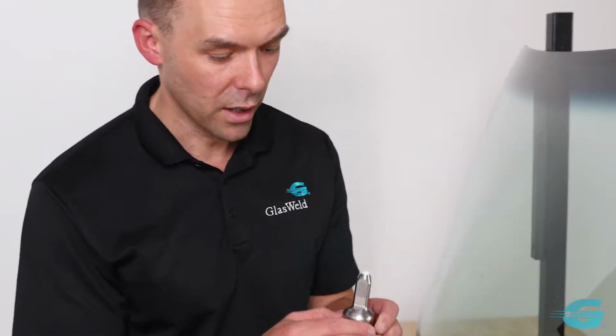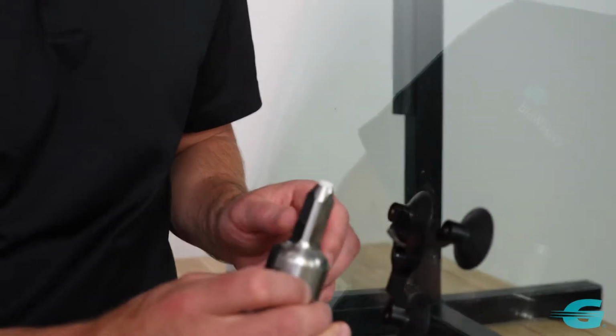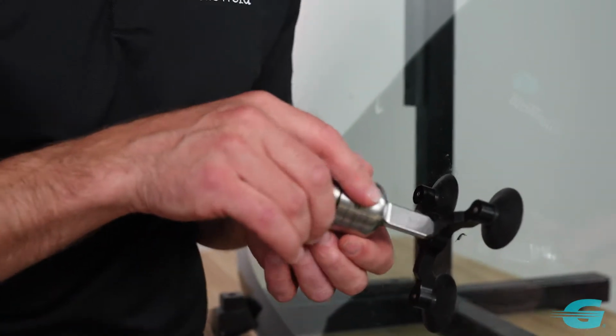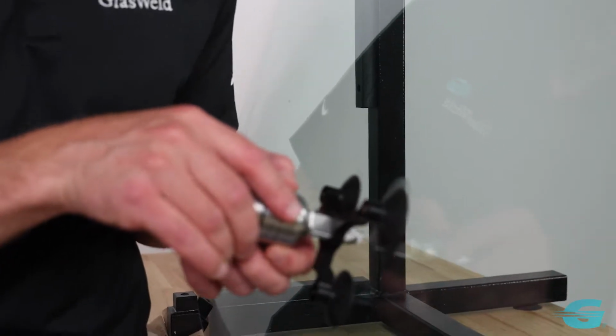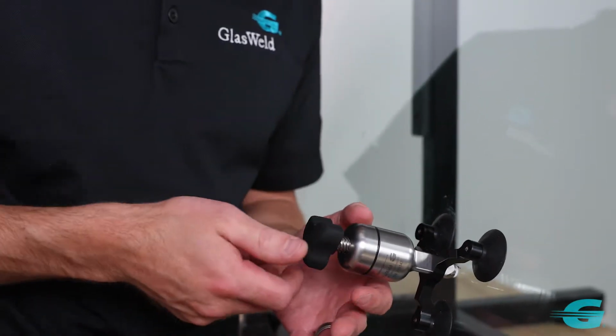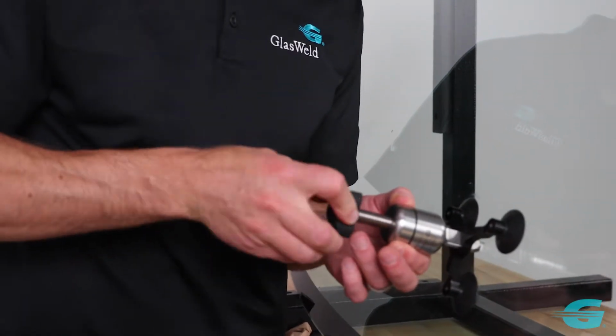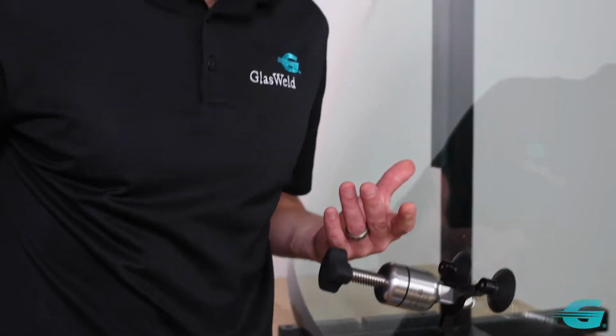the repair process. So the ProVac Zoom has these nice ratchet teeth here, which line up with this little ratchet paw, and that will make this installation process super fast, super easy. Goes right down until it touches the glass. One click, you get a perfect seal, and then all you've got to do is pull your vacuum all the way back until it stops. So this piston just threads up until it stops. That's it. So now we're pulling a massive vacuum.